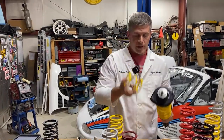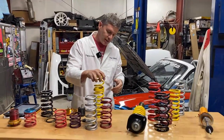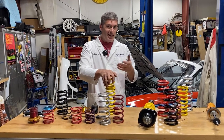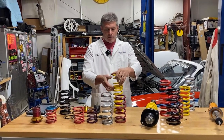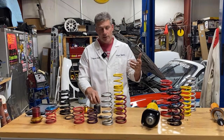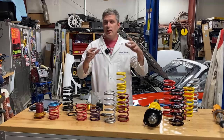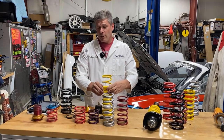V-MAXs will actually have the secondary start extending before the main spring is fully extended. I was running a weird setup with a 300-pound secondary spring with 450-pound mains — it acted quite differently. The idea was to give a soft, almost progressive setup with a very soft initial hit. This was when the car was being developed as a rally car. It was very hard to damp because you were either running at 300 or 500 pounds. The correct way to do that is to lock out the secondary at a certain ride height — that's an off-road thing. It felt really smooth over little bumps but there was a big change in behavior on hard hits. Interesting experiment, but it didn't make it into the Flying Miata catalog for a reason.